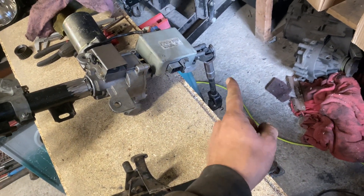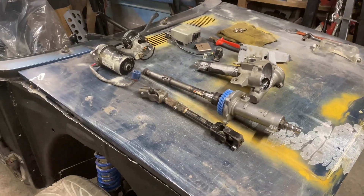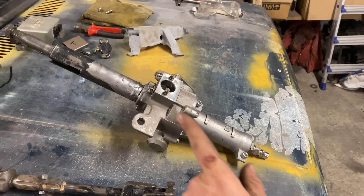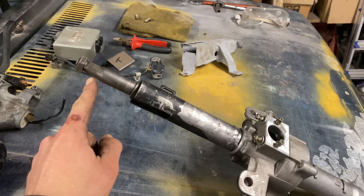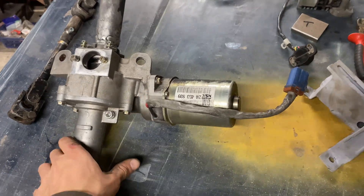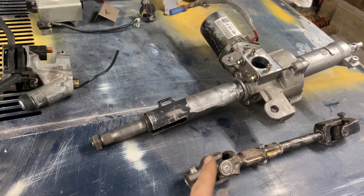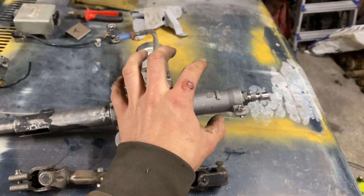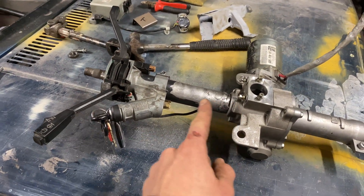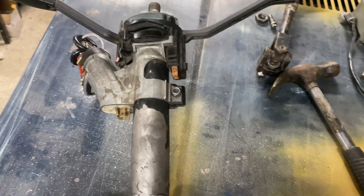Here are the two shafts I'm going to get TIG welded. I've now got those two bits back from being welded up. That main shaft just goes right through the column support tube and pokes out the top. The motor is now in place as well — nice and easy, just bolts up to the side, fits on a little spline inside with two bolts holding it on. You can see how it's starting to piece together. We've got essentially Mark 1 up at the top and everything else is Corsa — we're letting the electric power steering stay as it was. Because we're just running Mark 1 setup up here, the original ignition barrel, stalks, and all that stuff is going to fit exactly as it was, just as if it was on a Mark 1 column.